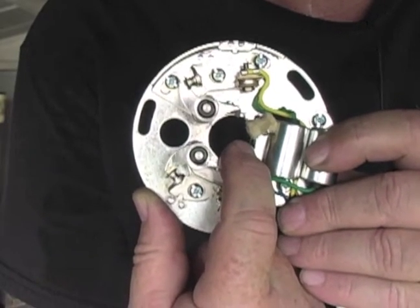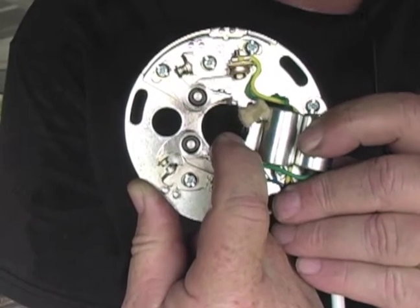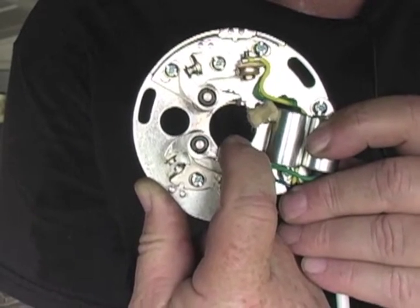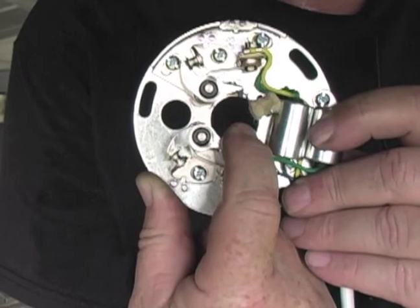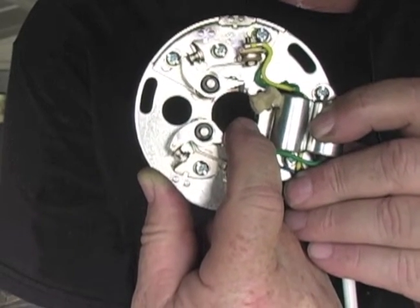Once that opens, these are actually connected on the ground side of the ignition coil primary circuit. When that circuit is broken and the current stops flowing through that primary side, the collapsing magnetic field is what energizes the secondary side of the ignition coil and provides the voltage necessary to jump the gap on the spark plug.